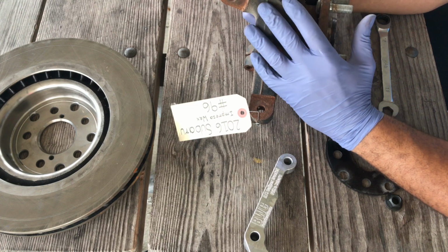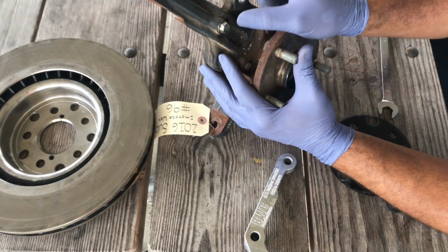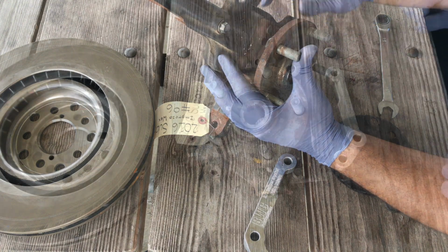The best way to fit this without having to cut your factory dust shield is just to remove the dust shield in general. At the top corner, if you do want to keep it, you would have to remove roughly a 2-inch wedge section off the top corner.